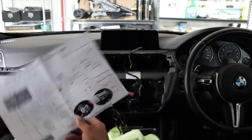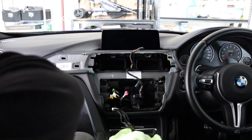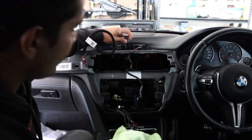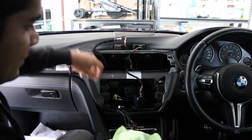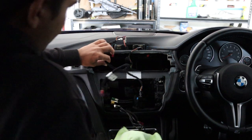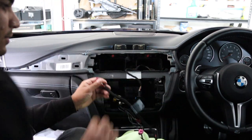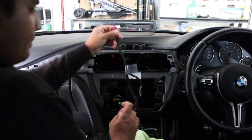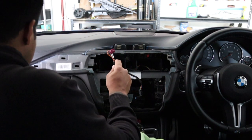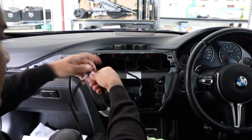You've also got your power harness and your CarPlay USB — pretty straightforward. There are two screws to remove the screen, then pop it straight up. Your new harness goes into that plug, and this plug here will continue into the factory radio — no need to worry about that one. Pull the screen cable through because that's going to go to LVDS out. Just make sure: this cable goes to the radio, this one goes to the screen. The screen side plugs into your new connector.